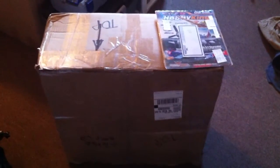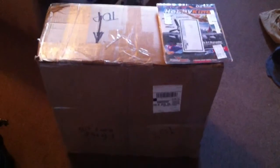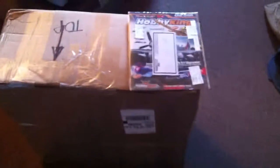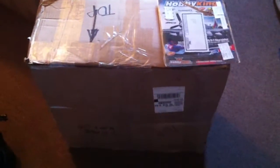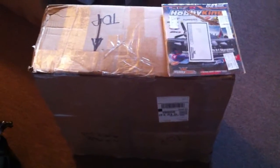I get back from my longest e-bike ride yet at 25 miles, and I have my new hub motor in the mail. This is a Crystallite X5404. I'll be able to put easily 20 to 24 cells on this thing and probably get up to almost 45 miles an hour. I also have some Hobby King items coming in — a bunch of Dean's connectors, wires, heat shrink, and an extra 5-cell lipo pack so I can run 15 cell.